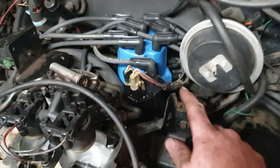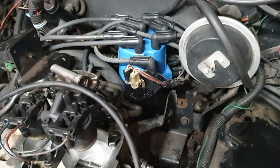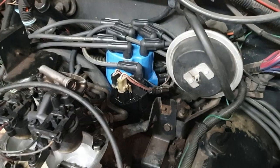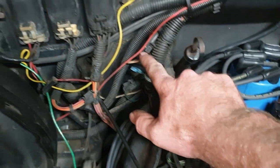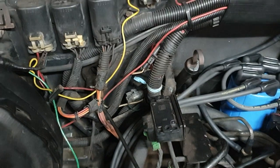I was just pulling tight on some of the wires. I ended up just moving the plug wires around 1 notch and reorientated it that way. Done the trick. So yeah, it's all running good. Set for 4 degrees. Don't forget when you're done to replug in the tan wire with the black stripe. That's for your timing bypass.